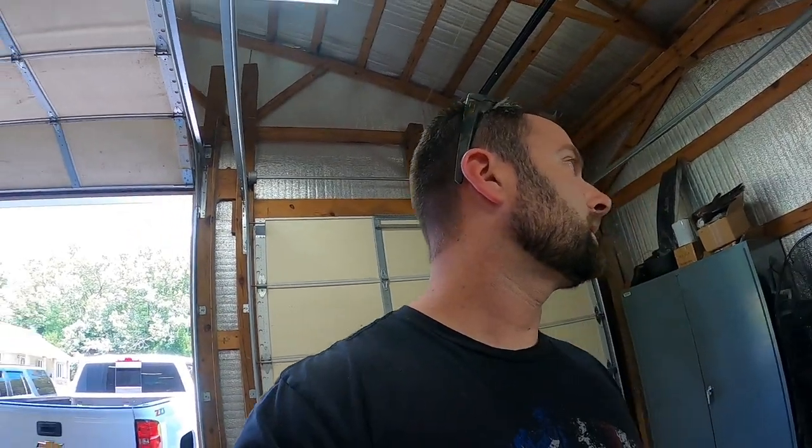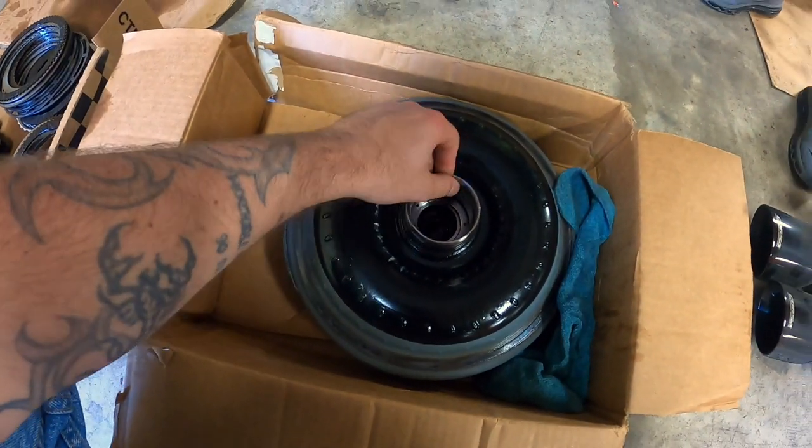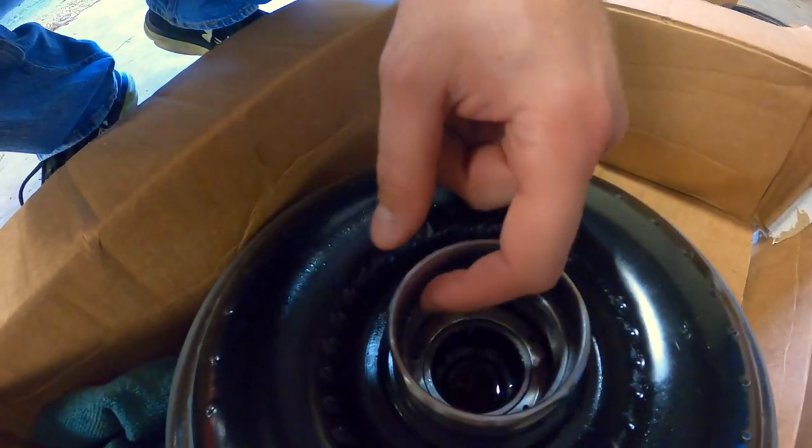It was definitely seated - I know people are going to say it wasn't seated properly in the video - but if that were true it would have killed the pump. We've got almost 5,000 miles on this rebuild, so it would have definitely broke before. This is a soft material, I'm guessing aluminum - most of it's not bad, it's just on this side here it's all bloated up. I was shopping all around the country for a valve body - it's like $400 - because everybody's like no we don't have any in stock due to COVID. I called one dealership and they were charging double the price plus the core - like $1,100 including core for the valve body.